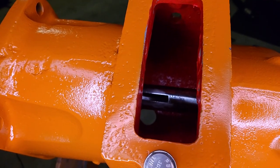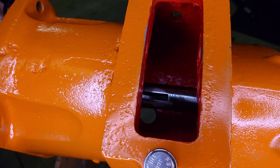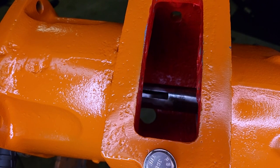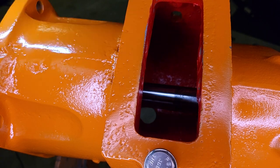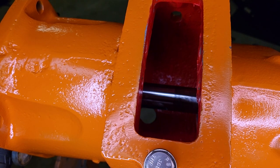Before I put that pan on, I want to go ahead and install the brakes - this is the part I've been dreading. I hear all kinds of good and bad stuff about this. Sometimes they slide on easily, sometimes the drum won't go all the way down. That shaft polished up real good, and this morning I polished the inside of the drum, so that should help it slide. I'm going to try it lightly without heating it first - see how easy it slides. I might regret that later, but I can pull it off just like I did the other ones if I need to.